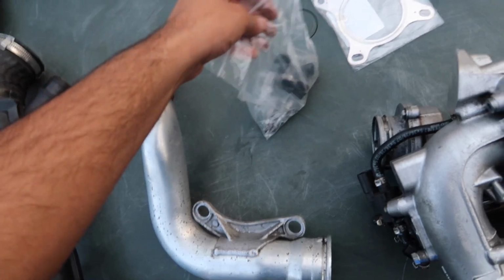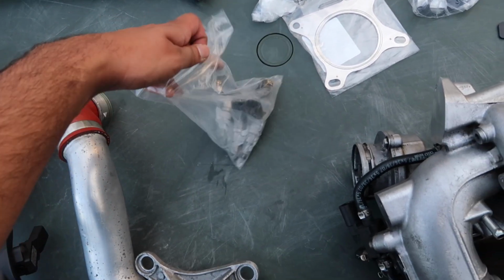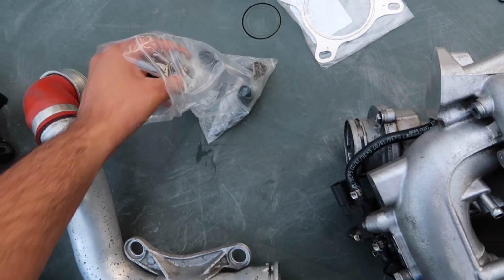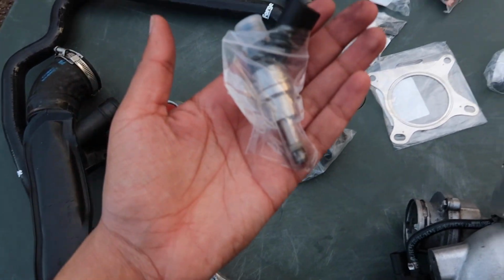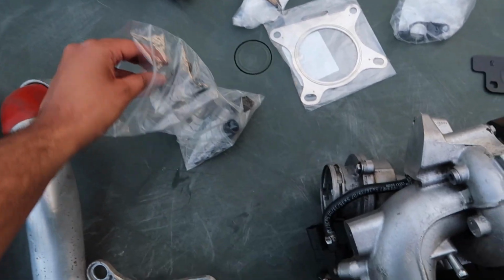Now also what we've got here, very important, we have got S3 8P injectors, or ED30, whichever way you want to call it. Apparently these were cleaned a year ago though, so I might get them redone. The turbo and the injectors I bought off a local Mark 5 GTI owner. He was planning to do the K04 conversion, but decided against it as some other circumstances came up.